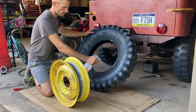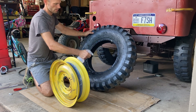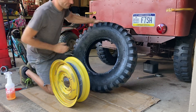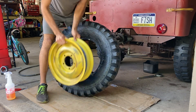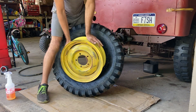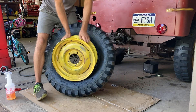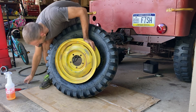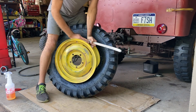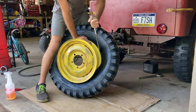Installing the tire with a tube on this Willys Jeep — no edits, all the struggles. Start with soapy water on the outside of the wheel facing out. Force it down on the inside. If it's directional, make sure you've got it going in the right direction.